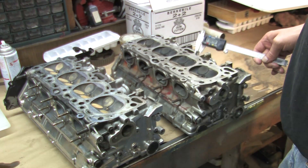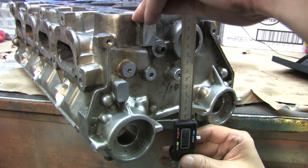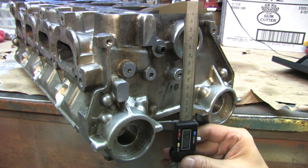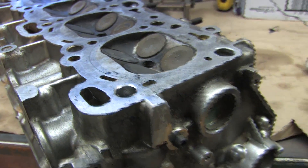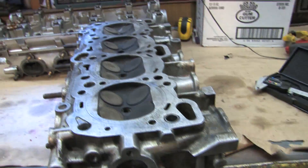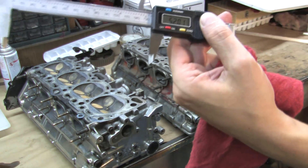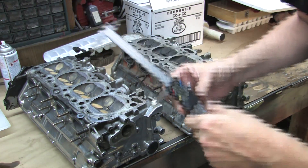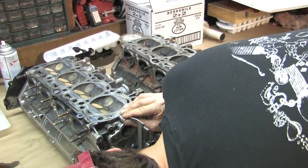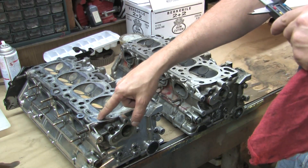I wanted to double-check that the spare head had not been resurfaced. The factory service manual specification for cylinder head thickness is 5.2 inches. Center your calipers perpendicular to the deck so they're square and get the smallest measurement you can find. Mitsubishi casts outcroppings on the head on both the timing and thermostat sides for measurement, and there are also milled castings on the intake and exhaust sides. When I measure my decked cylinder head, the smallest reading I can get is 5.185 inches — meaning I've had 15 thousandths shaved off — yet the unmodified oil port on the stock head is still deeper than on this decked head.